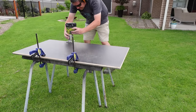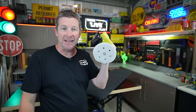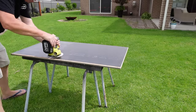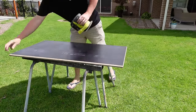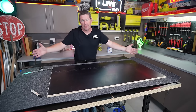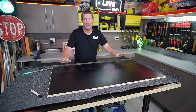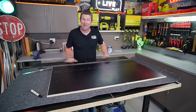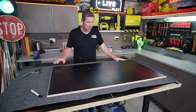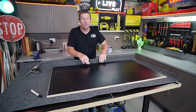So that was pretty easy — make sure you do both sides so you can wrap it all the way around. Now we've got our finished panel, all sanded off, all corners rounded. I pre-cut the carpet when I was doing the other section of floor and I've got around 8cm hanging off — that allows me to wrap it over and staple it all down without drama. You're better to have too much overhang than not enough; you can always trim it off once done.